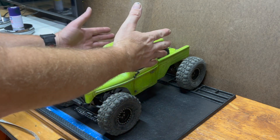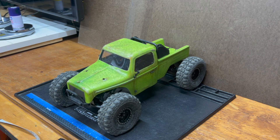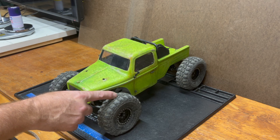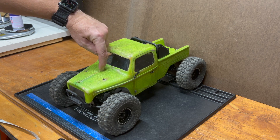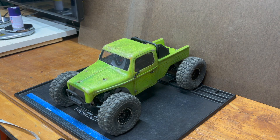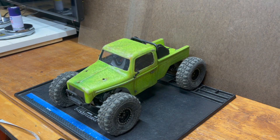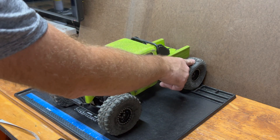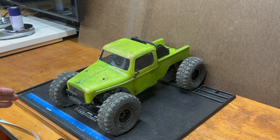We'll talk for a moment about side-to-side weight center line - where the center of gravity falls left to right. I honestly don't think it's that important unless it's really out of whack, because 11.044 centimeters from the center line puts the center right on this side of the hood - it's that far off to one side. What I do consider important is cross weight. Cross weight is the weight of this tire and this diagonal tire added together: for instance this one is 776 grams.